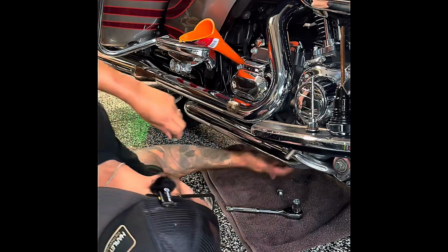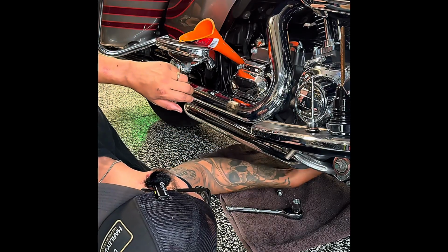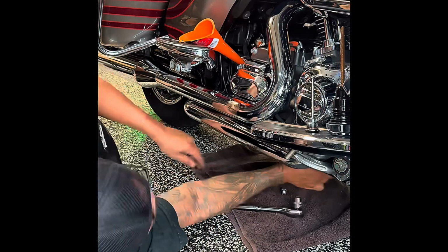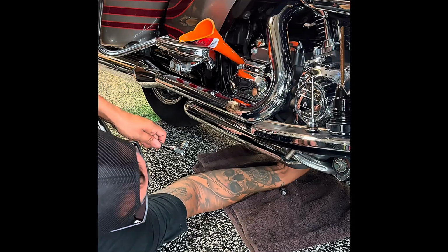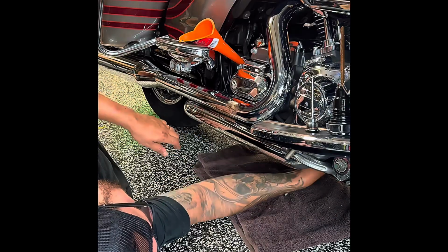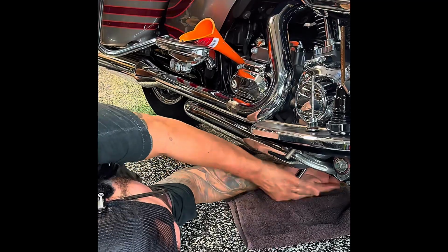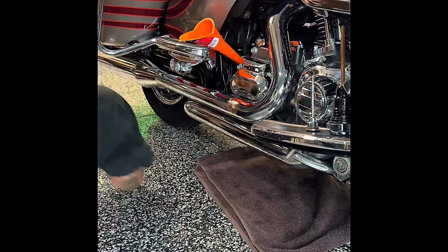I will tell you to just make sure you're using common sense when you're tightening it. I'll put in the specs for the torque. My torque wrench is not digital, it is a regular dial one, but it's currently broken and I have to order a new one. So I'm just gonna use common sense and not over tighten it. But I do believe that Harley calls for 20 to 30 foot-pounds. But we'll put that all in the description. Again, just use common sense when tightening things. Do not thread or strip or break anything. And we're gonna do the primary last on the other side.